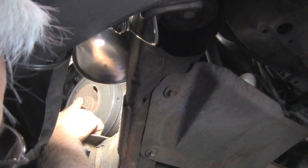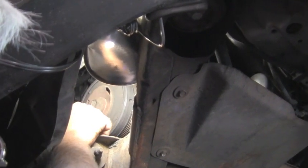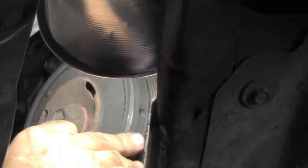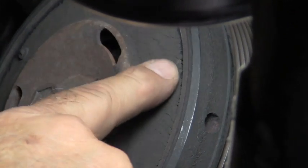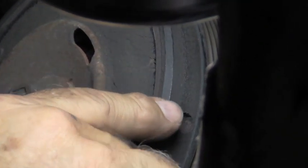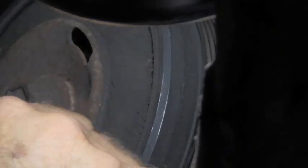This part is bonded through this rubber to the outer part, so when the middle turns, so should the outer part. But look what happens. This crankshaft is really a damper and it has this rubber part here. Notice that it's bonded to this steel — it's supposed to be bonded to this but it's not. It's broken. So that's where we're getting our noise.